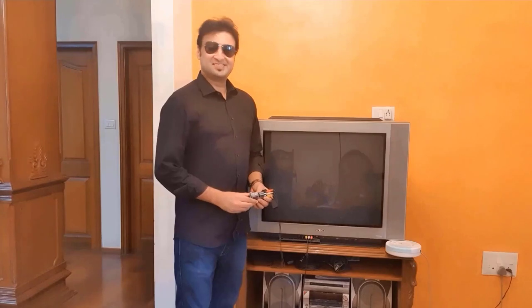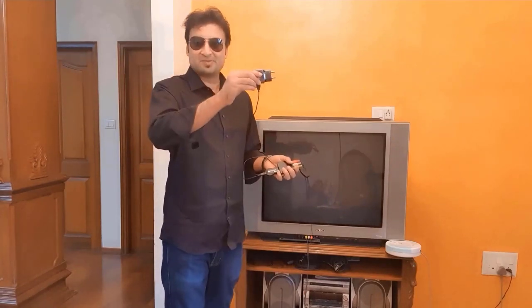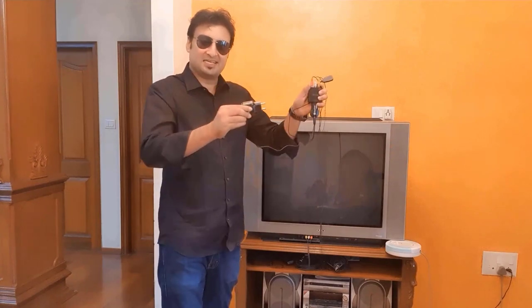You can't connect this directly to the TV. Only these RCA cables can be connected to that TV, so I'll be using this device to convert it to an HDMI. The RCA cables are connected to this box and to my TV, and now my TV is connected to Anycast. This ancient TV doesn't even have a USB slot, and that's why I'm using my mobile charger to power the Anycast.